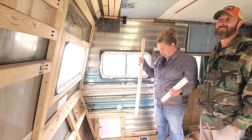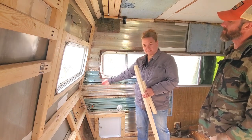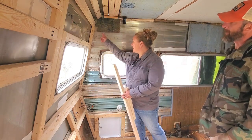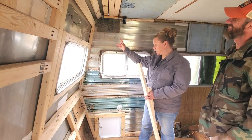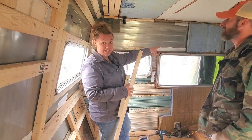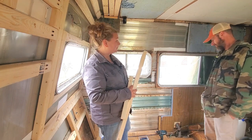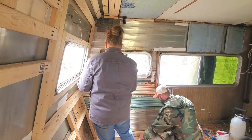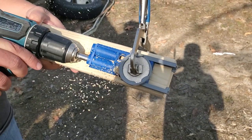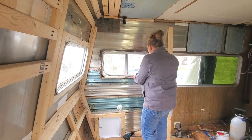While Tyler was working on the wiring I started cutting some boards to rebuild this wall. Our RV seems to be at about a 15-degree angle here, so I've got some two-by-twos cut to make a basic frame that will slip in this little notch. We're going to take the window out and start framing this in and re-support this side before we take anything else out. For the side wall we're using the same method as the back wall — pocket holes made with the Kreg jig and two-and-a-half-inch screws. It makes the wall so much sturdier than even from the factory.